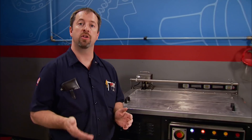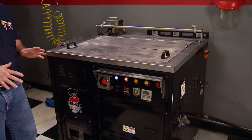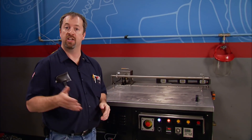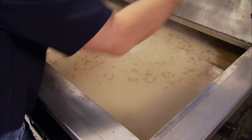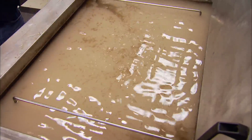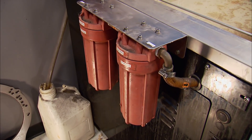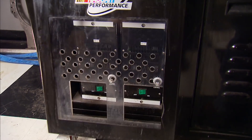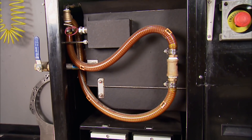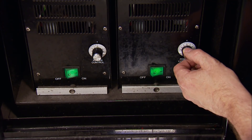Next up is a cleaning system used in all types of industries worldwide — from medical, firearms, and jewelry all the way up to aerospace. It provides benefits that other cleaning systems cannot. It is expensive, but pays for itself by doing its job so well. Meet the Safety Clean Aqueous Ultrasonic Cleaner. LS rocker arms are loaded into a basket and dropped into the 35 by 23 by 12 tank. The fluid is also water-based and heated, just like the jet washer, and is circulated via pumps through filters to remove contaminants and keep the tank as clean as possible. The heart of the cleaning action are these 40 kilohertz Genesis ultrasonic generators — they introduce ultrasonic sound pulses into the cleaning tank, up to 40,000 of them per second. You can adjust the intensity from 15% to 100% depending on the parts being cleaned. These waves are strong enough to damage certain materials like engine bearings, so be careful what you put in and where the intensity is set.